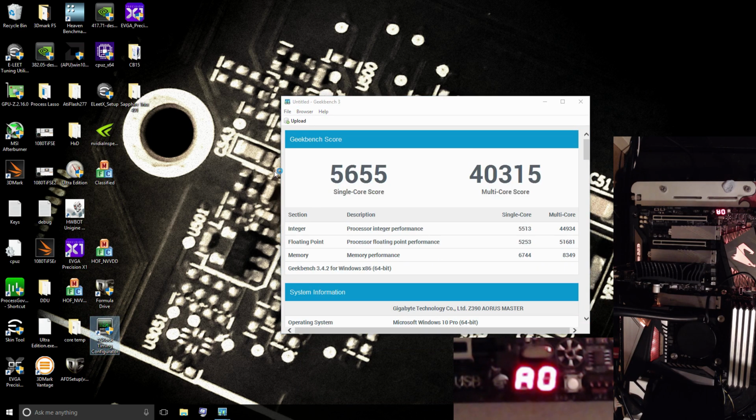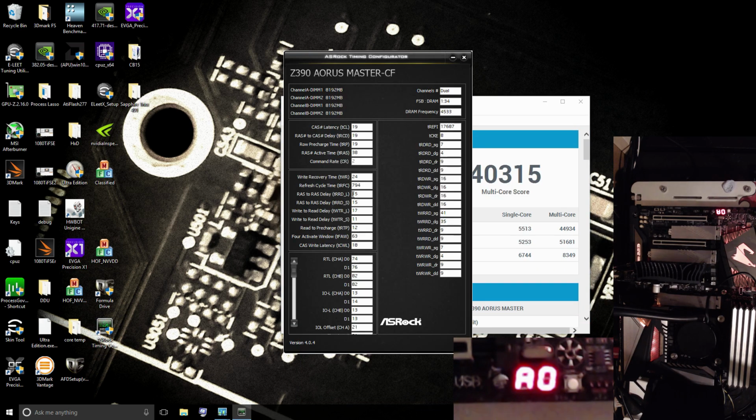And we can just open up Timing Configurator and we can clearly see this is terrible, this is terrible. I would aim for single digits on both of these, and this one probably around 11 or 12. Something like that. This one I'd leave alone. That looks fine. T-FAW is awful, which is no surprise. These are maxed out, right? 4 times 15 is 60, so that's why that's going to 63 there.